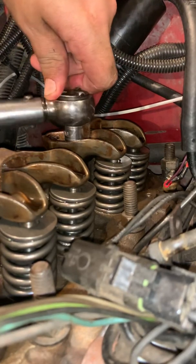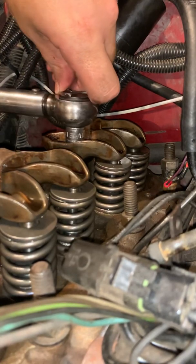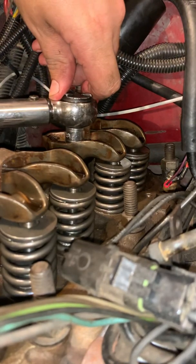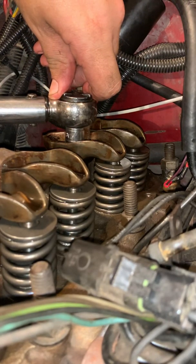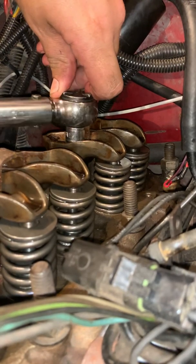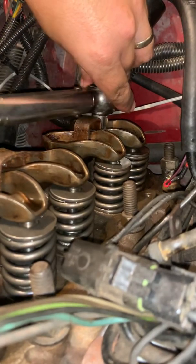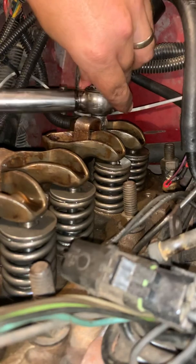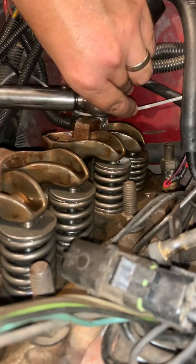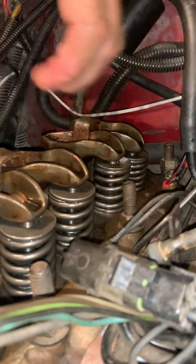Okay, now when we're torquing down, you don't want to just kind of give little things like that. You want to actually follow through with it, because if you torque and it meets right where that little click is, and there we go. That doesn't feel right. Go all the way through it. Push past it a little bit. Okay? The torque wrench is designed to stop you, so you're not going to have a big difference with that. Anytime you torque, you want to get a nice good swing, just like that.